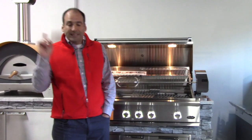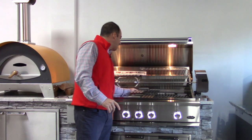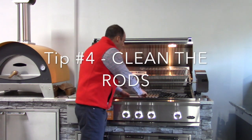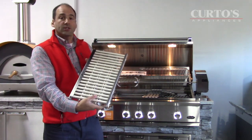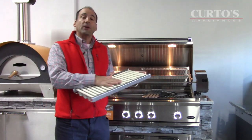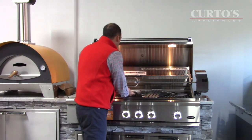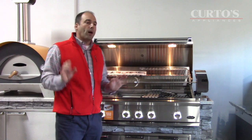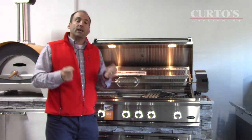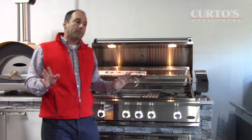In terms of cleaning — this comes up a lot and it's going to prolong the life of the grill. You need to be very careful, because whether you have a 7 series or a 9 series, your grill has ceramic rods in them. If something drops on them, they crack. You can get replacements, but that is one disadvantage of this grill — I wish the rods had more protection. So number one: be very careful when taking those trays out.